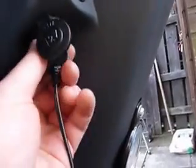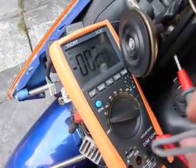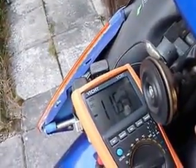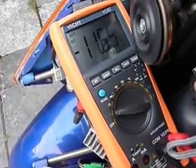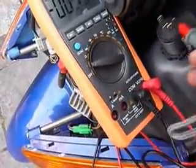I'll just hold it up and see what we're getting. As you can see, I had the terminals the wrong way around, but we're getting 11.6 volts — and that's practically nothing given it's very late in the evening with not much light around. I tested the panel earlier and it was giving 17 volts in direct sunlight. It's good that it's working and we're getting power to the terminals.